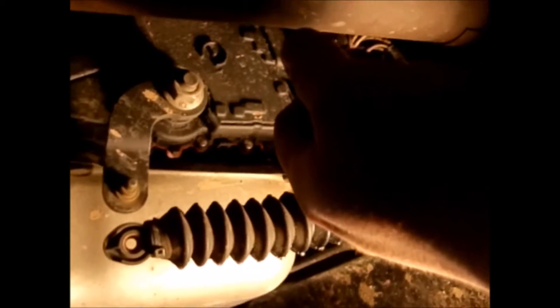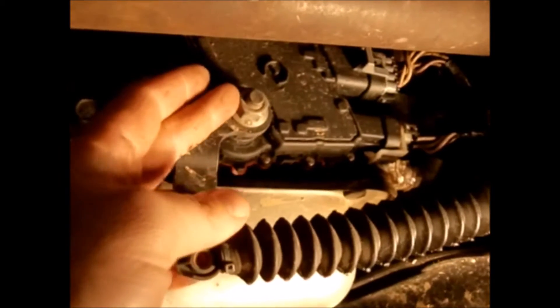I'll tell you the steps and then show you the finished product. Your shift linkage comes off very easily — you can probably take this one off by hand. It snaps off. If you have trouble, take a small pair of needle-nose pliers and pry behind it, or use a screwdriver wherever you can get in. This nut right here is a 15 millimeter. Make absolutely certain your truck is scotched — use the parking brake and chock the wheels.